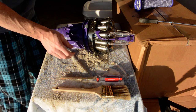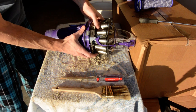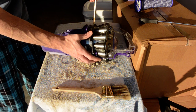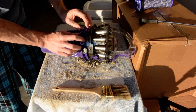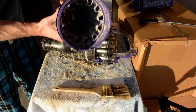With the basket being removed, it gives you the option to then remove the next part, which I've already done. That's where the larger screwdriver comes in. You'll see these slots right here — use the large screwdriver and slowly work each spot that has these points. Do it very carefully because you can break this piece of plastic. Once you get that apart, this piece comes off and then you can get all the dirt inside the area you want to clean up.